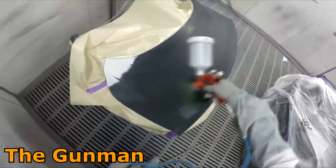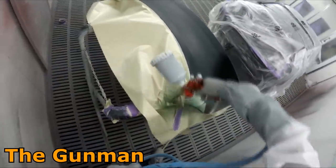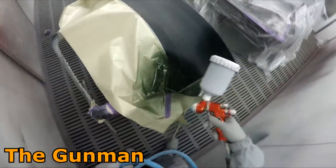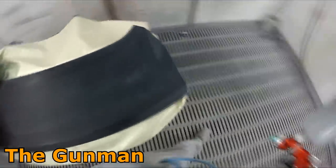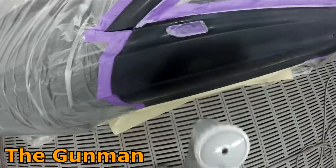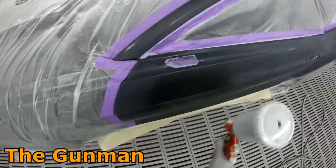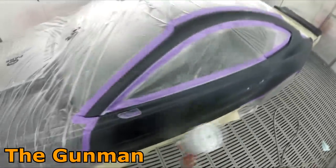Anyway, as you can see, I've wiped the entire job down with tack cloth. I did that like 3 or 4 times, used the air blower as well. I have edited the entire video down. If you were to see everything I did, the video would have gone for a couple of hours, probably a little bit more than that. But yeah, I've edited it right down, and all the flash off times, I've edited those out too. But it really isn't taking long for this paint to dry in between coats.